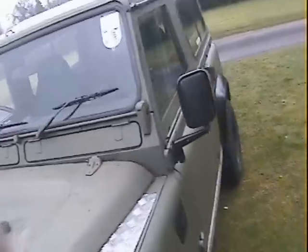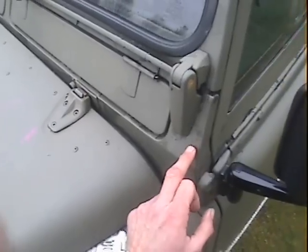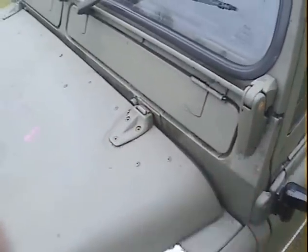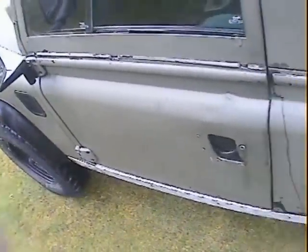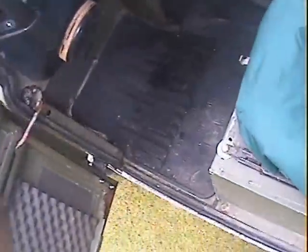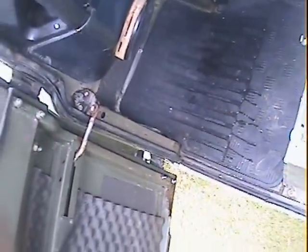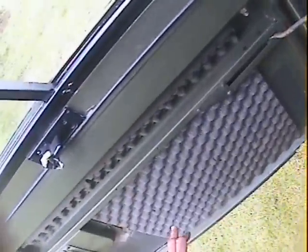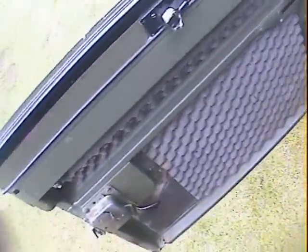It's certainly straight around here. Scuttle corner and top — a little bit of bubbling just coming up on the very edge of the scuttle corner, but not broken through at all. The rest looks very, very good. A-post looks fine. It's got military doors with the sliding windows, which I prefer. Both footwells have been plated, driver's and front passenger's. The passenger door frame is rotten just there — nearside door frame is rusty at the front and at the back.